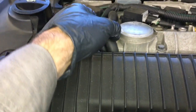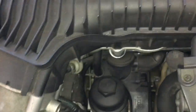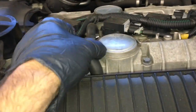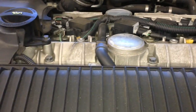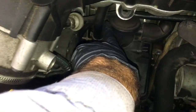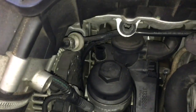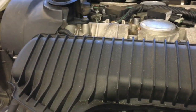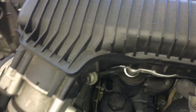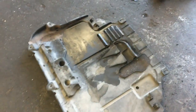Since we're replacing this hose, I'm going to cut it off with my knife, pull it up through the intake manifold, cut the clamp off, and take it off completely — cutting as close as I can to the body of the housing. After cutting the hose, I'll go ahead and pull it through. Then I'll rack the vehicle up, get it in the air, and take the lower shield off. After getting it up and removing the lower shield — which just had bolts around the perimeter — follow them around and remove them.